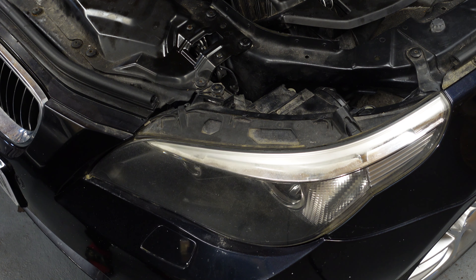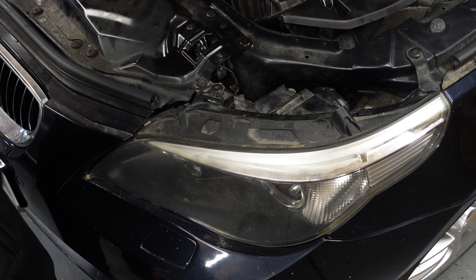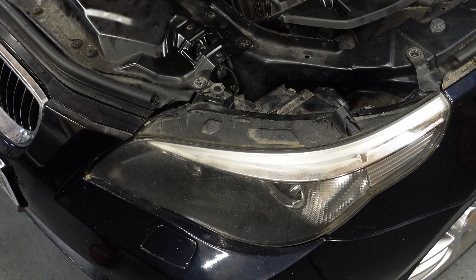Many of you have probably been through this many times of how to remove the headlights on these cars, but I'm just going to go ahead and do it so you guys can see how it's all done. You can see there are Torx bolts we're going to have to remove. You've got a slam panel here we're going to have to take off to get the headlight out, because it's got a big bracket that sits just underneath the bumper which is going to be in our way. Those are Torx 30s — all out very quickly.